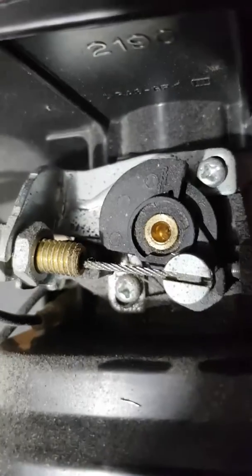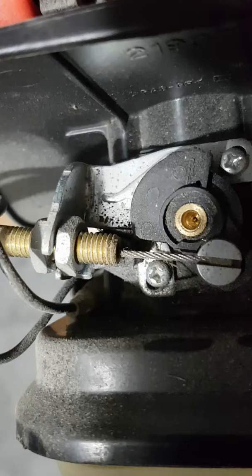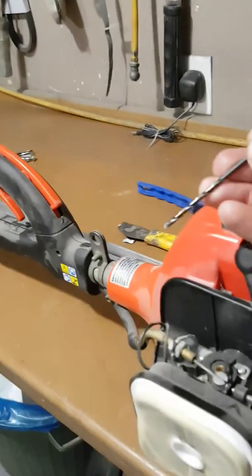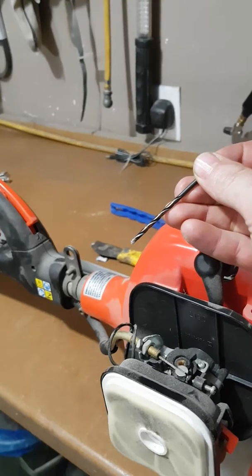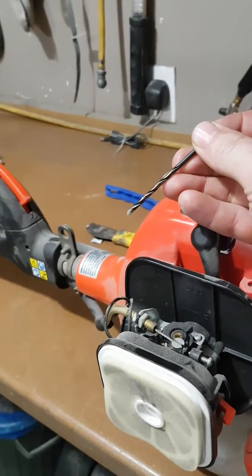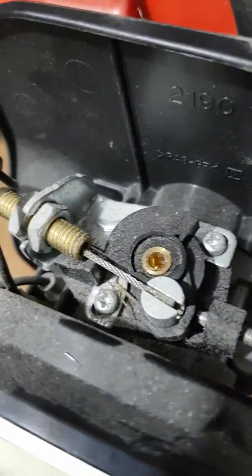Let's see if I can get this positioned so you can see the slots — it's in there. That little nylon plug comes out easily. You heat up your drill bit, drop it in there, push it in, let it cool off, and then pull it right out. Obviously you're not going to be able to put that back in, but that's how you get to your low speed adjustment. Thanks for watching.